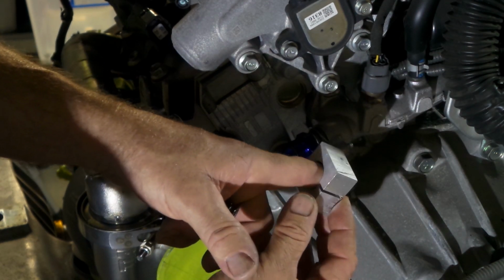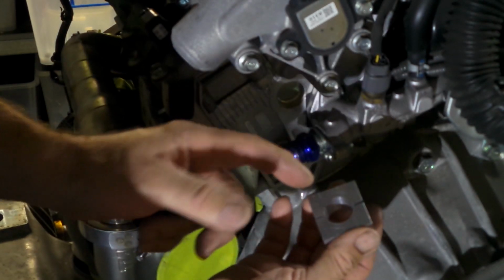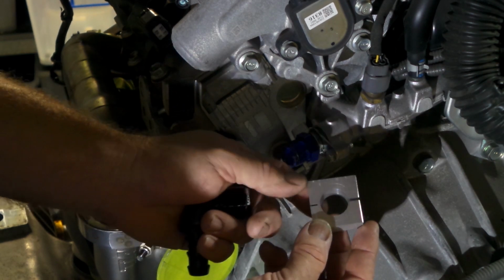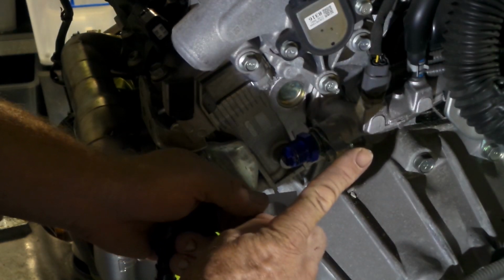Look, even a piece of wood will work to give you enough clamping force on a round item so that you don't destroy it while trying to clamp it, and it also locks in position so that you can do a process like tapping or something like that. So just a tip for young players there, folks.